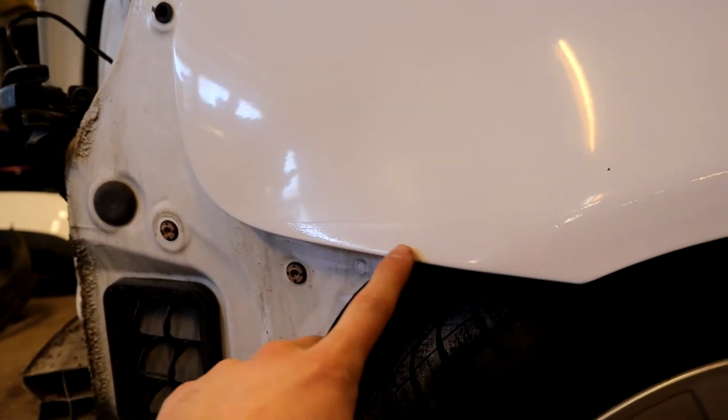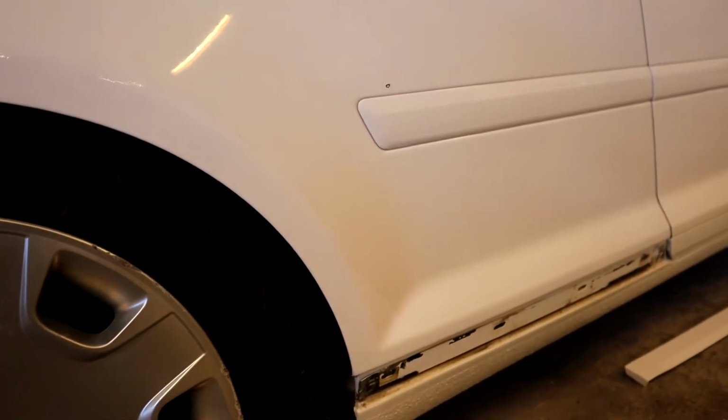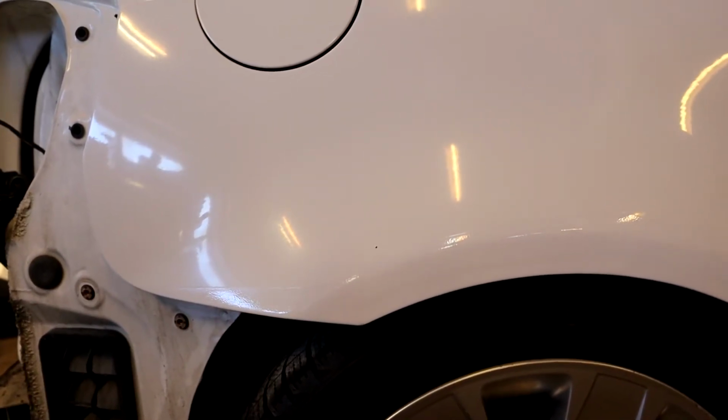And today it's day 2. Well, today it's the same video for you, but for me it's a new day, and the paint is not dry yet. It's been, I think, 14 hours ish, and it's not completely dry yet, so that's very strange. It's better than before, but the car needs to be polished, and we need to wet sand this one because it's orange peel paint. That sucks, but hopefully we can get rid of the difference of the paint, because it's the same color code as the car, so hopefully.